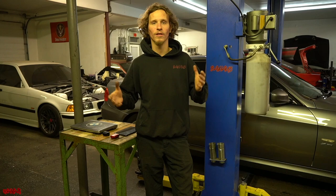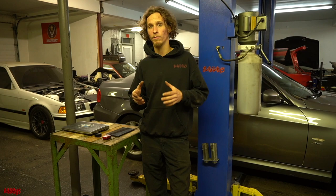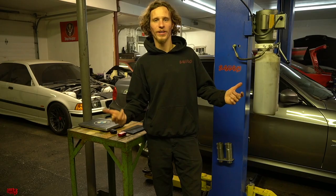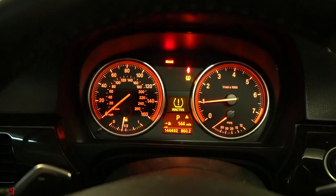What's up guys, it's Mike from Bathhouse TV. Behind me today we have an E90 328xi that is throwing a bunch of lights on the instrument cluster related to the brake system, the ABS system, and the transfer case system. In previous videos on our channel we've shown how to solve this issue by replacing a wheel speed sensor and a wheel bearing, but in this video we're going to show you a third issue that causes all these lights to illuminate: the transfer case actuator. Between the three videos you should be able to solve whatever issue is illuminating that christmas tree of lights on your dashboard.